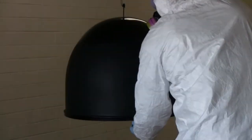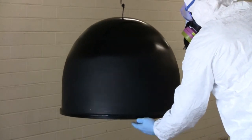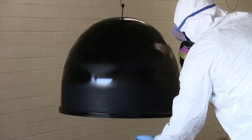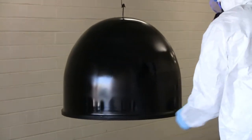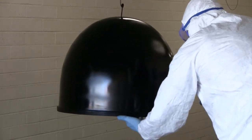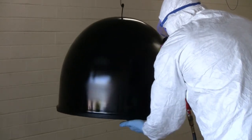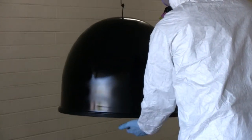I have some time left in the day, so I'm going to get a head start on finishing the bowls with black cobalt paint so that I can do some more heat testing. I've tested the heat characteristics of a few different types of timpani bowls in the past, and this black cobalt paint will not only conduct heat, but will also act as a nice base coat for the silver mirror that I intend to apply later. It's important to apply this type of paint in thin layers. I could have matched the original factory bowl color or used a different color from a standard can of spray paint and finished a day or two early, but I wanted to do something different and special for this video and for my own testing curiosity, so I used the black cobalt as my base coat.